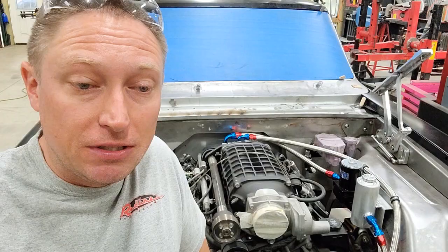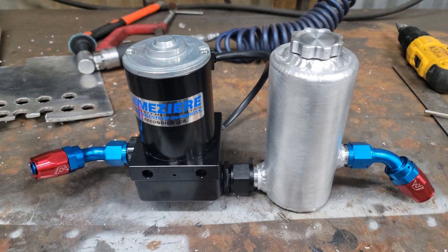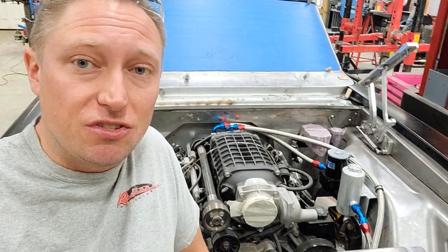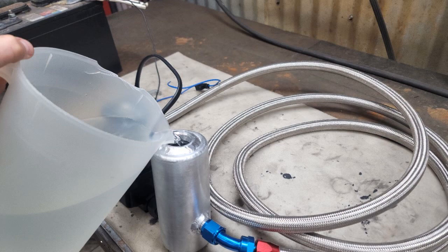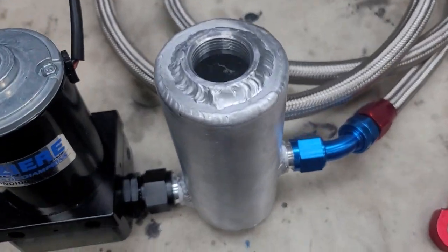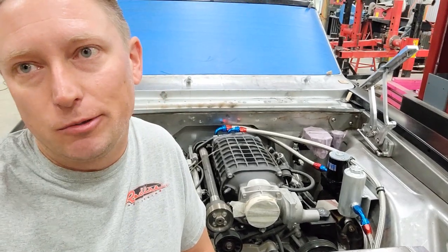Once I had my reservoir built, I basically just connected it to my pump, and then in order to simulate it being in the car, I took a hose and connected one side to the other to make it a circular system, poured some water into it, and hooked it up to electrical power just to check it for leaks — make sure that none of my welds were faulty, because if we're being honest, I am not exactly a professional aluminum TIG welder.